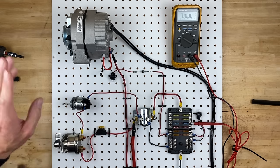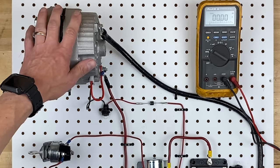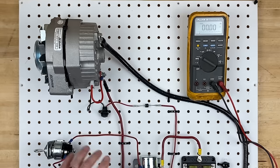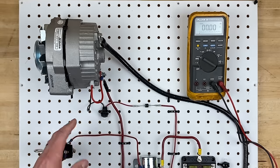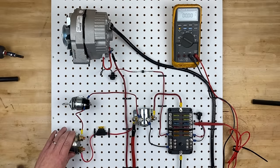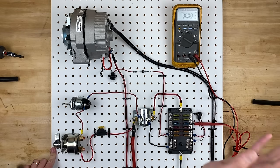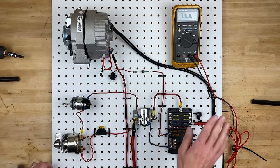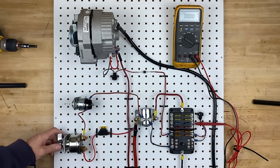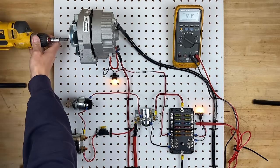We're now ready to test out the alternator and there are two things to watch. First is the dummy light — it's going to turn on as soon as we turn on this key and then turn off as soon as the alternator starts charging. The other thing is you're going to watch the voltage go up on the multimeter. We're going to start at about 12 or 12.5 volts and it's going to rise up to between 13 and 14 volts when this thing is actually charging. Then we're going to turn off the master switch, the fuse box is going to go dead, and the voltage is going to read zero. Then we'll turn the master switch back on, the fuse box will become powered again, and we should see 13.5 volts on there again. First we'll turn on the switch then the key — see, we have the light bulb and we have about 12.5 volts. Now we'll start the alternator.